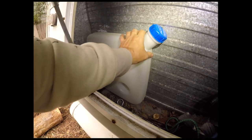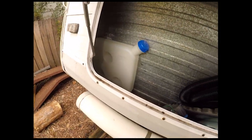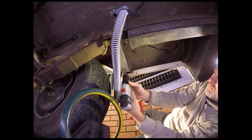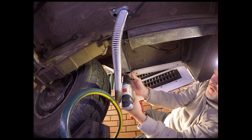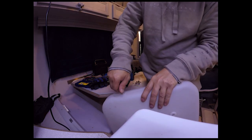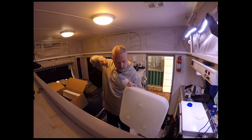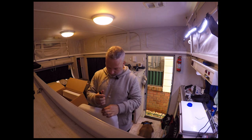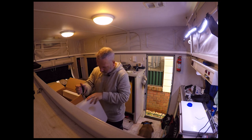This is just our fuel line running over to our fuel pump. The reason I put the fuel pump over here is I wanted it as close as possible to the fuel tank itself, and by putting it over here it also put it as far away from the bed as possible. I don't take too kindly to repetitive noises while I'm trying to sleep, and this pump does click while it's running. I am going to try and isolate it a little bit better, but you will hear an audible click from within the caravan while this is running. It's not terrible, but I could hear it even when one of my mates couldn't — and his daughter could too. So if you've got reasonably sensitive hearing or it's very quiet, you're definitely going to hear that.